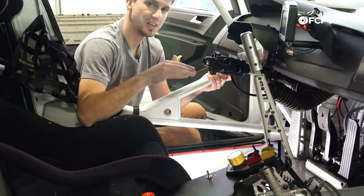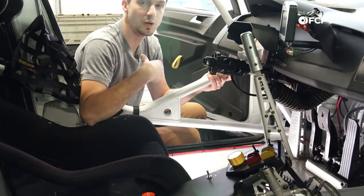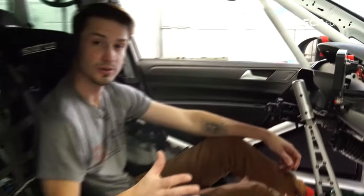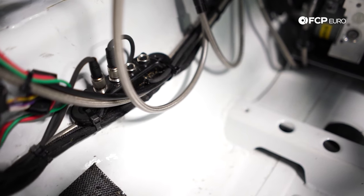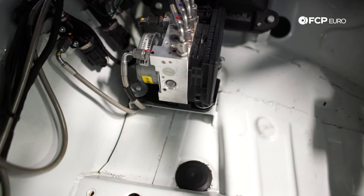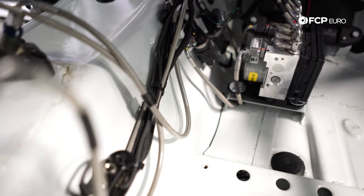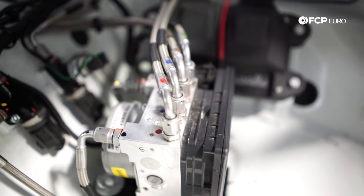What this actually does is cut off the peak pressure to the rear. If the bias is too far back and the tires are too cold, when you stab the brake pedal really hard, the rear wheels will lock up, creating a very unstable car. Now over to the other side — looking at the plumbing and the ABS. All the plumbing is done with soft stainless steel lines. Race cars don't have to be road legal — there's a DOT rule stating you can't have a soft brake line longer than 18 inches in a street car, which is why you always have a soft line attached to a hard steel line. In a race car we don't have those rules, so we run Teflon-lined stainless steel lines throughout the entire car, making servicing much easier.